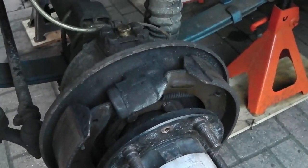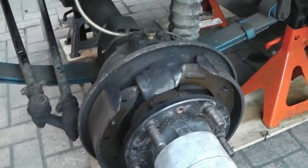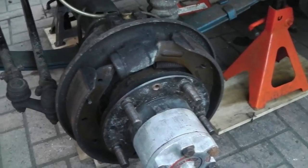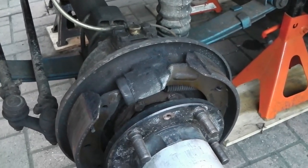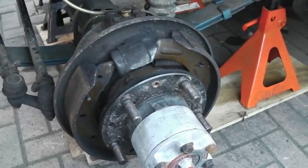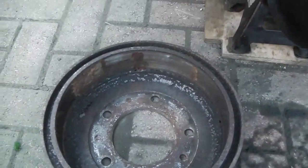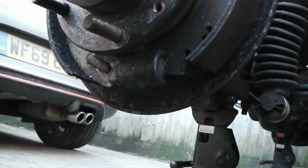So this is why we're doing the overhaul - it was the front brakes that were really the problem. The vehicle had been pulling left and right a bit and it was clear that I had sticky wheel cylinders. When I went and got the vehicle MOT'd, as soon as I came out of the test station I could feel it pulling. It was obvious that one of the wheel cylinders had started to leak, probably as a result of the extra pressure applied on the brake roller tests. You can see it's actually sat there leaking quite badly - look what it's done to the drum. I'll have to clean them up and see how they come up, but yeah, it's all a bit of a mess.